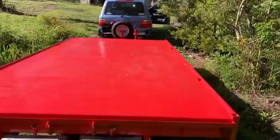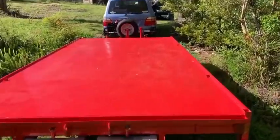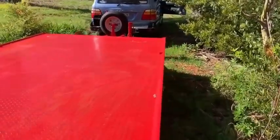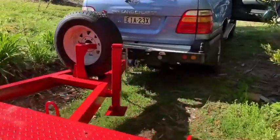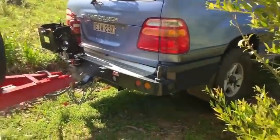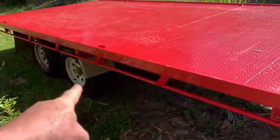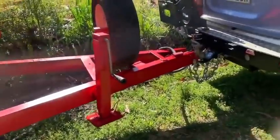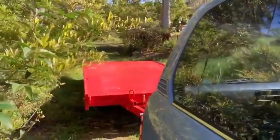So this is what we're going to be reversing down there — that is 2.4 metres wide, a very wide trailer. The total rig is about 11 metres long. What makes a trailer a lot easier to reverse is the distance between the back wheel and your tow ball. Reversing a little box trailer, aside from being hard to see, is actually harder than reversing this. The issue with this is physically the size and length of the whole rig.